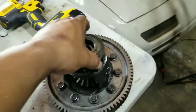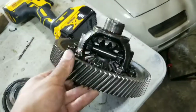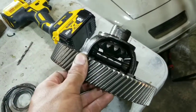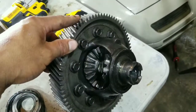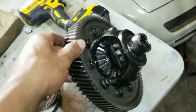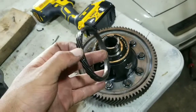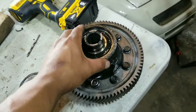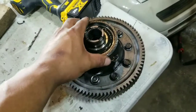And then the other thing, I'll have to look up the part number for you guys, but you could actually buy this ring gear. This is for those of you that watched my video on putting Type R LSD on a K20A2 tranny. This is my old diff out of it with a 4.7 final drive ring gear, just because I kept it. And good thing I did, because this is going to come in handy. Instead of buying it, having to order it and wait for it, I just removed it, because most likely I will never use this. Or I will, I don't know, who knows.